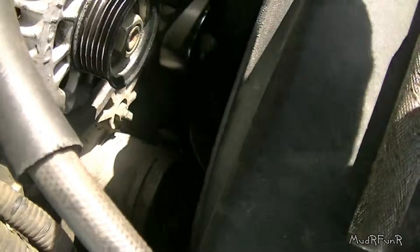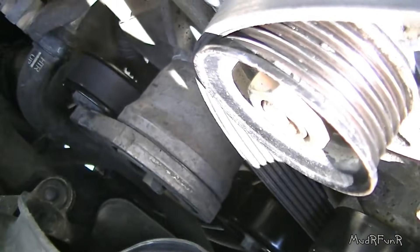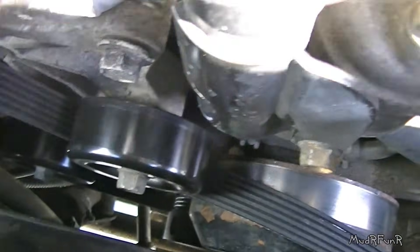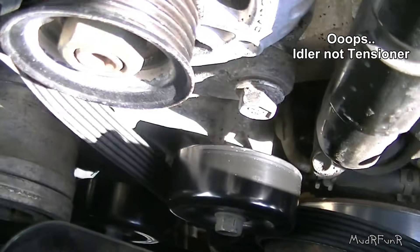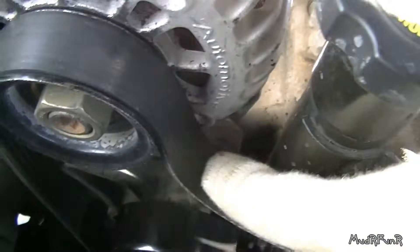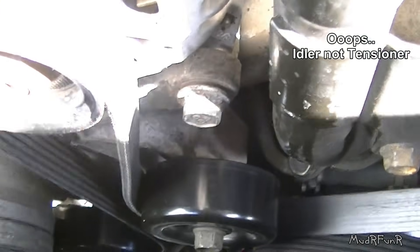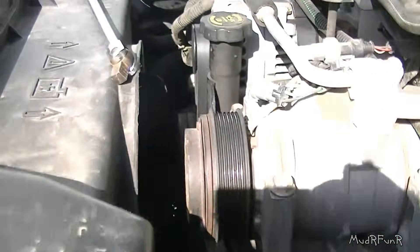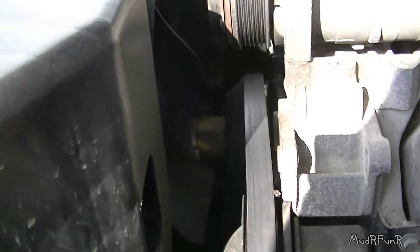When you're reinstalling the belt, the best way that I find is to put it on the crankshaft first. Now that I've got the belt wrapped around the idler tensioner there, I've got the one flat side up against the water pump, and this piece here is coming up in between the two tensioners and then it has to go up over top of the alternator, back down underneath that tensioner, and I usually wrap it around the power steering pump. The belt is on top of the alternator with both sides coming up over top of the water pump.